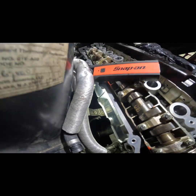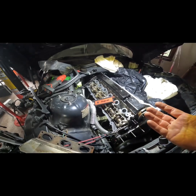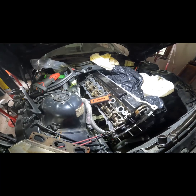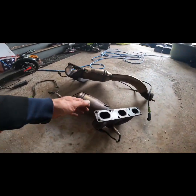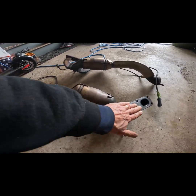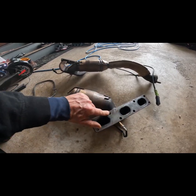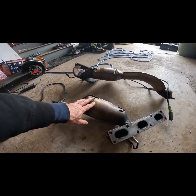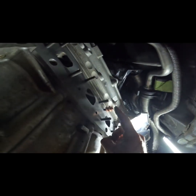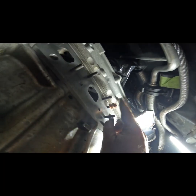I just had to take off a couple of the extra studs I put on, and I'm going to go ahead and feed the cats in from the bottom, and then I'll be able to get them bolted up. One thing to keep in mind when you're reinstalling your cats is clean the surface area — I use Scotch-Brite to clean this up. There is a bit of a gasket, so you're going to be okay with a little bit of corrosion, and I blew them out with some air just because they've been sitting so long. Remember, the best way to move a stud is the double-nut method — just tighten the outer to the inner, and then you'll be able to take that stud out.